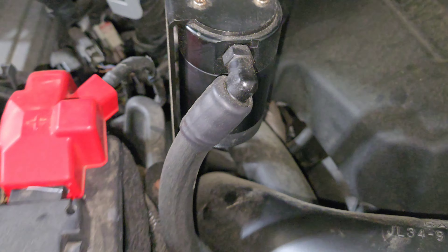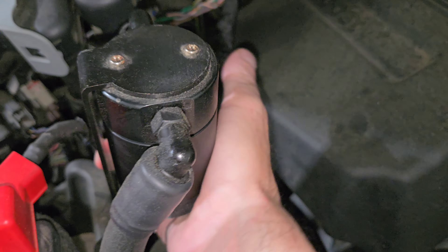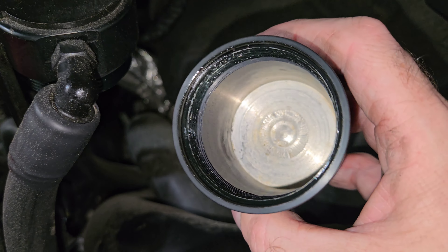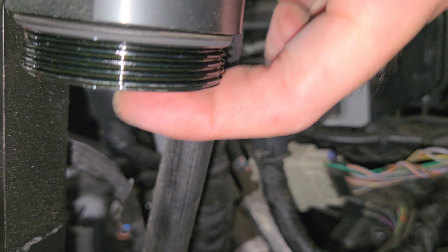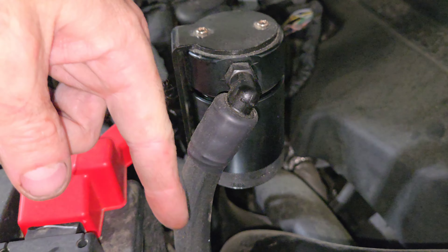I already emptied this and my GoPro overheated, so I'm going to see if I can turn it and get it off and show you that it collects down inside here. Mind you, it's already cleaned — it was about three quarters of the way full. That oil collects down inside there and all I did was clean it with some brake cleaner and dump it out. It's baffled inside. The oil vapors, once they get heavy enough, instead of flowing in the airstream, they fall down inside here.